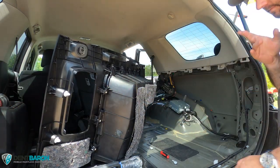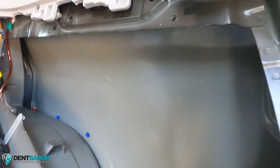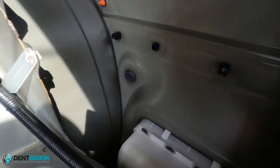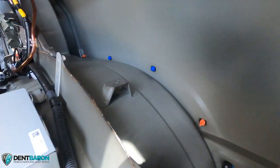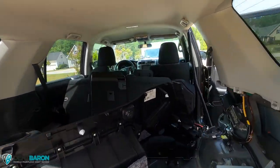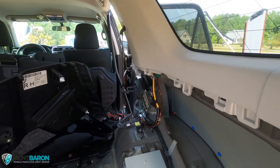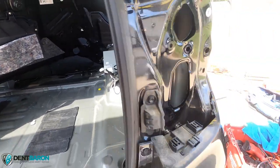You can see that huge area on the back side of that trim panel — that whole area is touching the quarter panel, no access through there. The leverage is terrible for this dent through that hole. Look at how much open space there is in this panel — there's the dent, it's sharp. You could take the bumper cover off and go through the vent cover down here to get access all the way up to the window. For severe hail damage, it's a must to take that out.